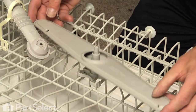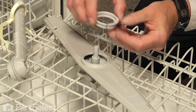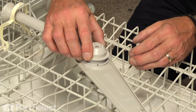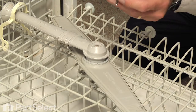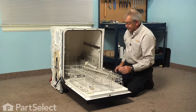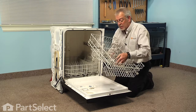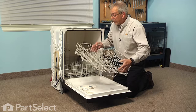Rinse the whole thing and put it back in position. Simply slide the new bearing into the opening on the spray arm and then fit the supply tube over top of it. Replace the Phillips screw and just make sure that the spray arm turns freely, and we can slide that rack back into position.